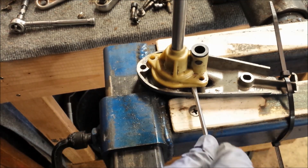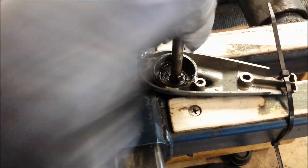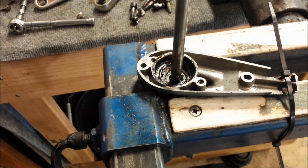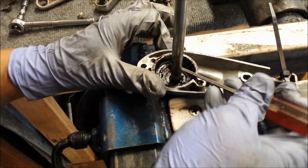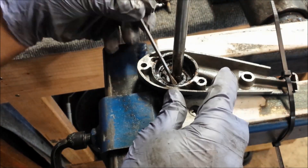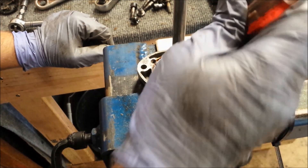I don't want to pull the drive shaft out because then you've got to realign the pinion and it doesn't always go back in, so what I'm doing is holding the drive shaft down while I pry that up a little. Looks like this one's gonna come out in one piece, so that's good. And there's our little water pump — we'll take it apart later and see what it looked like. Now we have this little plastic base, pretty well stuck in there for some reason. It's got to come out. Now I've got to get in there and clean all this gunk out. I don't know why these things always attract gunk, but they always do.